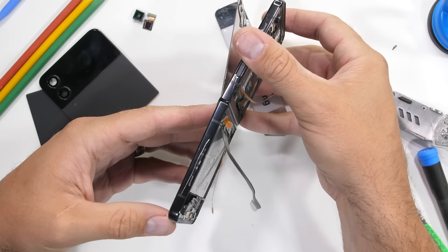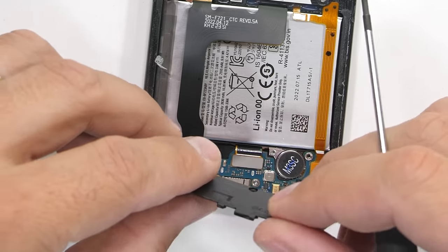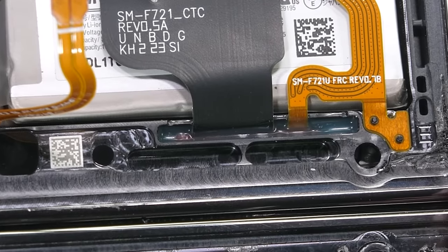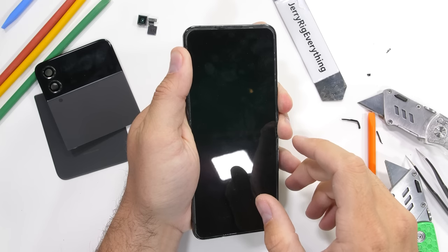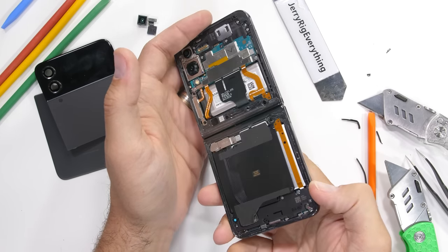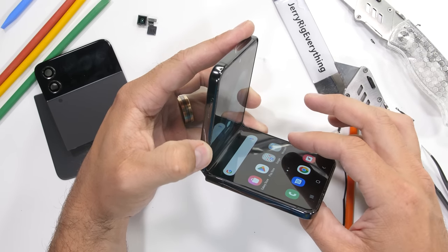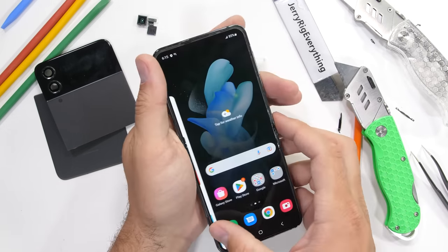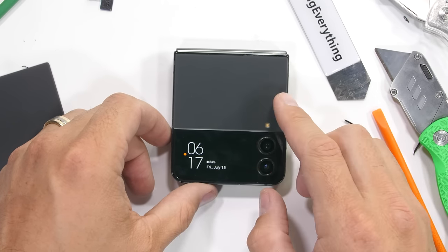With the motherboard back in place and its plastic screwed down, we can poke the screen ribbon cable through the phone body and attach it to the charging port board before dropping the bottom loudspeaker plastics into place. The rubbery goop keeping the phone watertight probably also doubles as protection for the ribbon so they aren't chafing on the metal. The wireless charging pad goes on along with the metal plates. And moment of truth — it has indeed survived. The Flip 4 folding phone has suffered through a complete durability test, a teardown, and has returned to the land of the living. Rather impressive engineering and construction from Samsung. There has never been a phone so strong yet so weak in all of existence. I'll toss the rear display back on so we can make sure everything is functional — and indeed it is. The Samsung Z Flip 4 is as good as new.